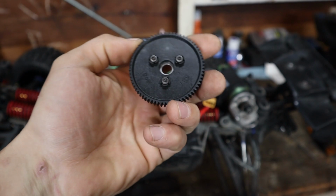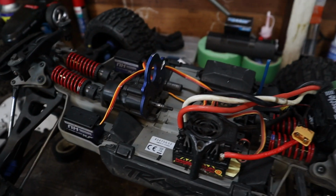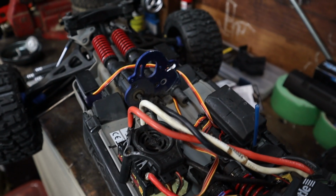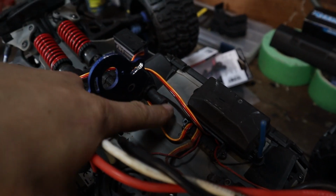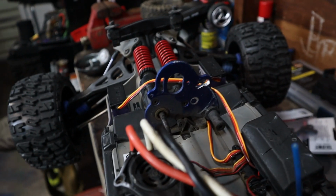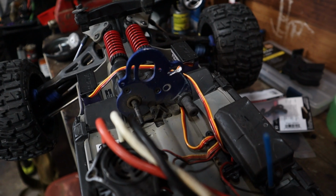So I was wondering what was going on, and one of the things I think is going on, this plate just flexes a whole lot. Like, a ridiculous amount of flex. Once you get the motor on there, it relies on this bushing here and then one screw to pivot. And I thought there was something up, because I have an 18 tooth on it, and it said an 18 tooth is what was stock.